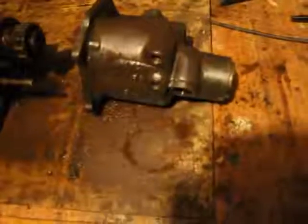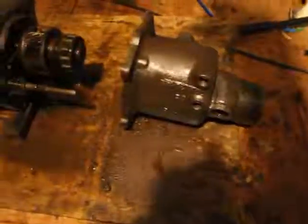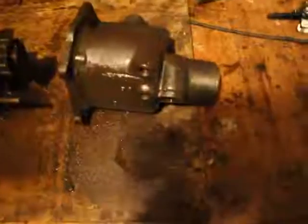It should go here. In my case, it did come out with just a regular pulley puller. I sort of had to have some help because it's got three jaws, and obviously only two of them will fit around here. It won't fit on this side. But it came out like it was built yesterday, really easily. You might have to tap it with a rubber mallet if it doesn't come out easily. If it's stuck, go back and forth, putting some oil or diesel, whatever you're going to put in there. Don't just try to take it out all at once in a single try. If it comes out a little bit and you're starting to put too much force into it, hammer it back in and then back out again, patiently, and it'll come out eventually, in the vast majority of cases.